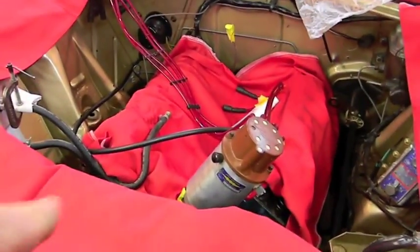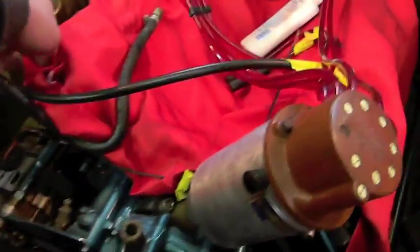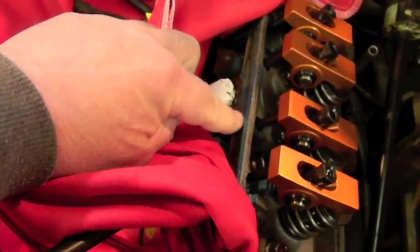We have to just clean a tad bit more in one or two little tiny places. Basically what I need to do is just clean off that little strip. Yeah, maybe this side we can see it better. Maybe not. Just a little strip in here that you're going to see above the intake when I bolt it on, and then clean the mating surface. And one or two small things, and we're going to get this base on.